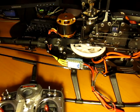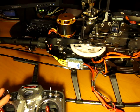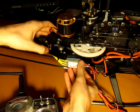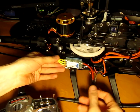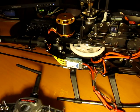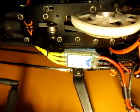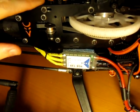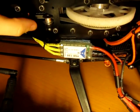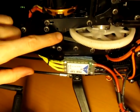I have the YGE connected to my Outrage helicopter. Basically it's all ready to go. I just used some velcro and a couple zip ties. This unit is pretty light so you don't have to worry about it too much. As far as programming goes, before we get started, the first thing: just make sure you've backed out your pinion from the main gear. It's very likely this is going to start up when you're doing the programming, so you do not want the pinion engaged.